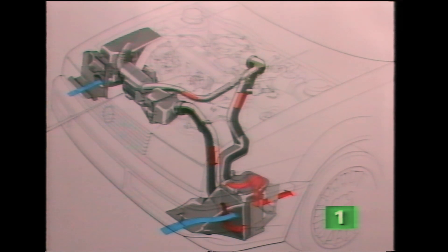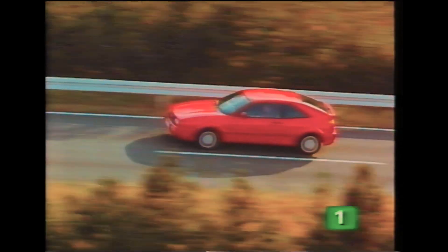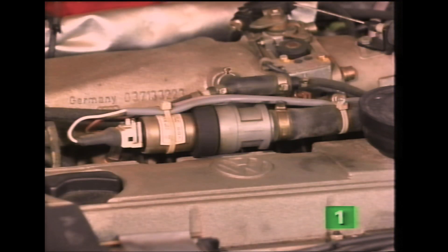The operation of the G-charger, in conjunction with the bypass valve, limits the maximum boost pressure to about 0.7 bar. Under certain conditions, to reduce engine knock — particularly in the upper load and high rev ranges — it's necessary to regulate accurately the boost pressure. This is carried out by activating the idle stabilization valve, depending on information received by the Digifant control unit.